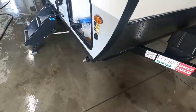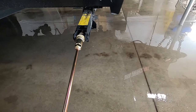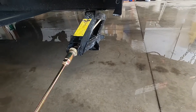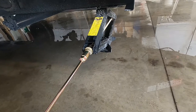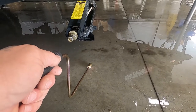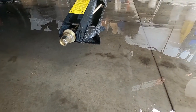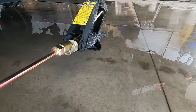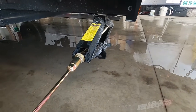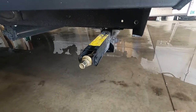Once you've got your unit level, the first thing you do is stabilize the unit. You have stabilizing jacks on all four corners — by hand, three-quarter-inch crank downs — just crank them down until they're taut. Remember, these are stabilizing jacks, not leveling jacks. You're only going to bring these down just until they're taut. Preferably use stabilizing jack pads — get a four-pack from our store with your 10% off coupon — that'll protect the feet of your stabilizing jacks from dirt, debris, and hot blacktop in the summer and keep them from sinking. Run all four down, making sure you don't lift the unit and change the levelness of it.